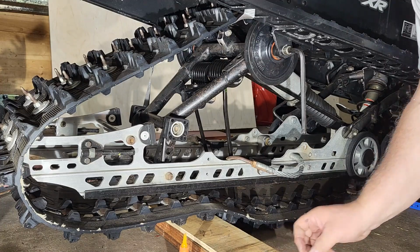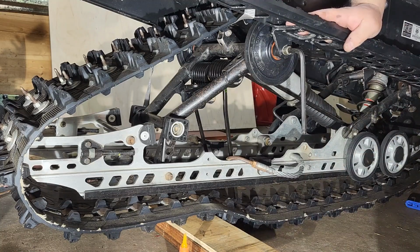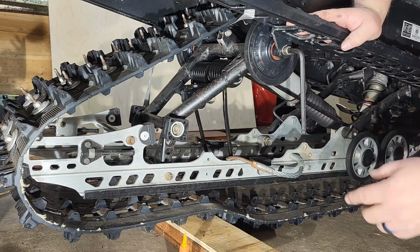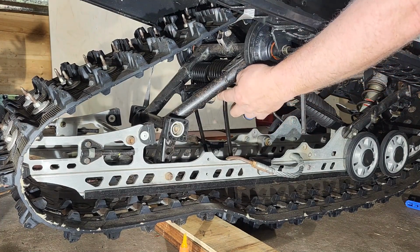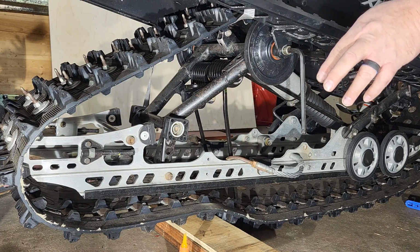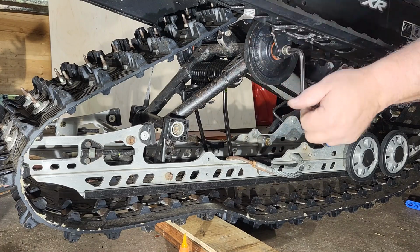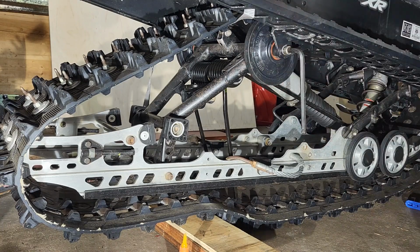The reason why I'm not using a pneumatic tool to put it all back together is that I don't want to risk cross-threading the bolt into the axle. On both axles, this one here and the leaf spring one, there's a spacing of about maybe a 1/16 of an inch where there's no thread, so it gives you an opportunity to line up the bolt. But it's best to do it by hand because you can feel if you got it threaded correctly or not.